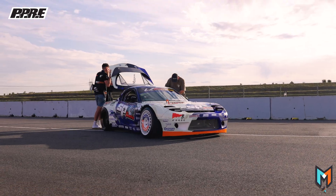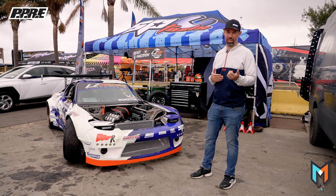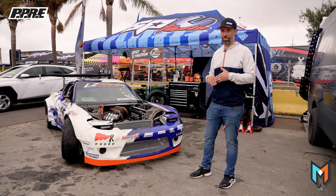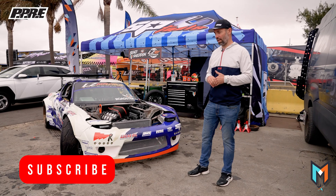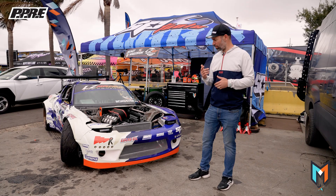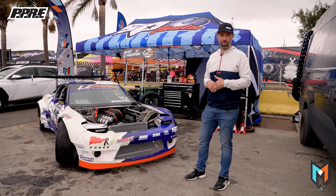This is actually the third six rotor that we've built. The first one was a local one and the second one we did in China — we flew over there, fitted it into the car, and did the tuning, and it's still running well to this day. This one is the first billet six rotor that we've built. The engine is built up mainly from 13b parts — high compression rotors, billet centre plates, and 13b rotor housings — with all our own custom porting, intake and exhaust manifolds, as well as our own specifications on the throttle bodies.